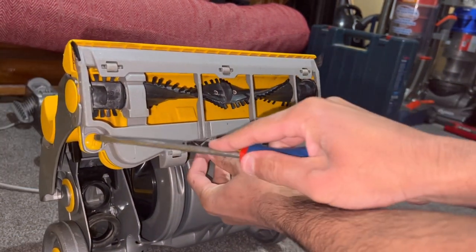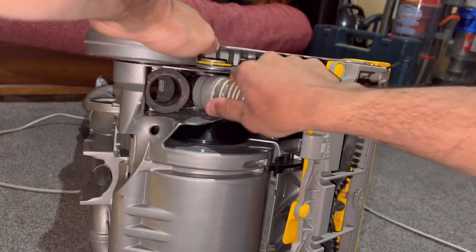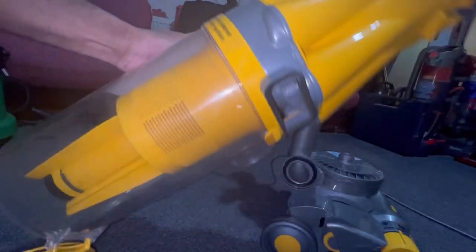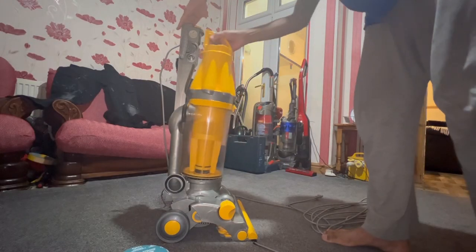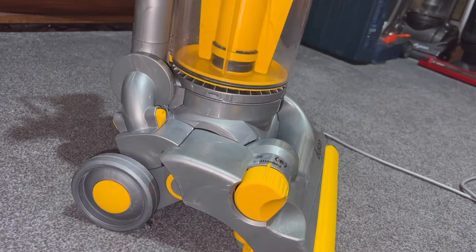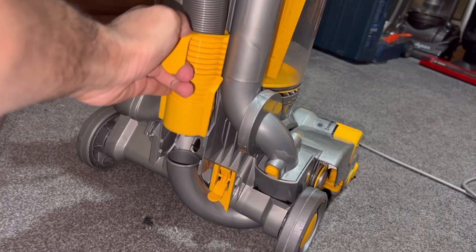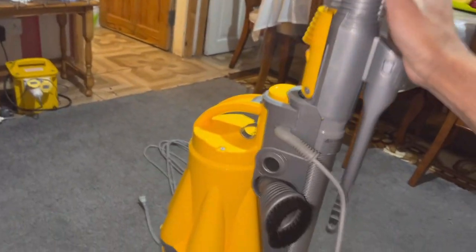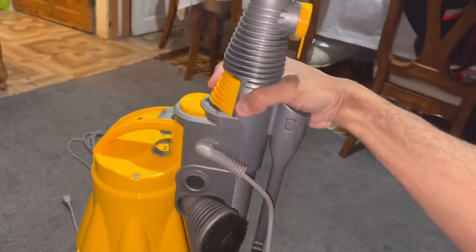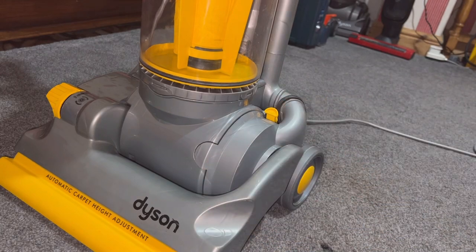For the sole plate you can use a coin — it's effortless. Now watch me put it back together rapidly. Turn the three screws, twist the internal hose on and pop it into the other end. Put the cyclone and bin back together — it clips into place with a secure lock on the back. Close the bin flap and put it back on the vacuum. The valve pipe clips into the side, the U-bend clicks onto the base, and the hose slides down until it clicks into place. Slide the wand into the hose, push it home — it locks. The filter goes into the housing and the vacuum is fully assembled.